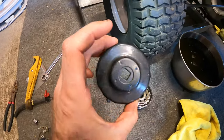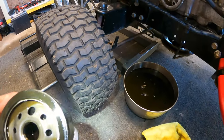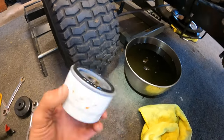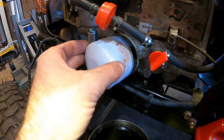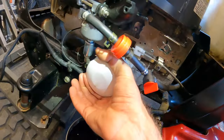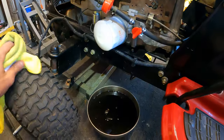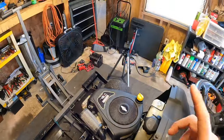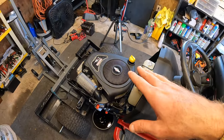I did a little bit of wrestling with some of my strap wrenches, but I remembered that I actually had a Briggs & Stratton filter socket. That filter was on there — it actually dented it just taking it off. Anyhow, I got the old one off, just dipped my finger in and wiped around the O-ring and also wiped up a little bit around the sealing area. We'll go ahead and pop on the new filter and just hand-tighten it — just snug it down. It has a good O-ring so you don't need to get crazy, because then the next time you go to service it you're going to have a heck of a time getting it off. We've got that all done — I'm going to go ahead and top this back off with some fresh oil, crank it back up, make sure we don't have any leaks, and then we can move on to the mowing deck.